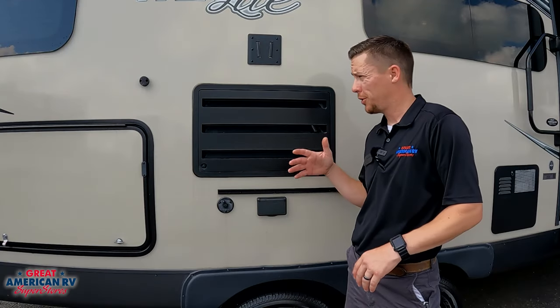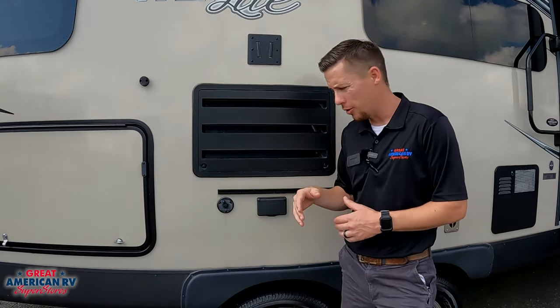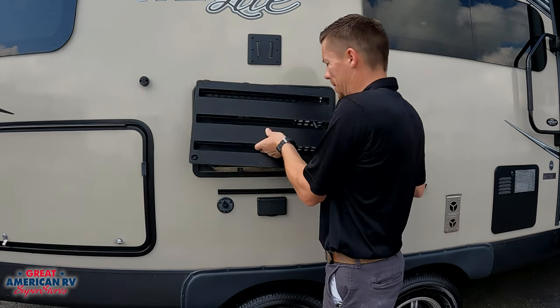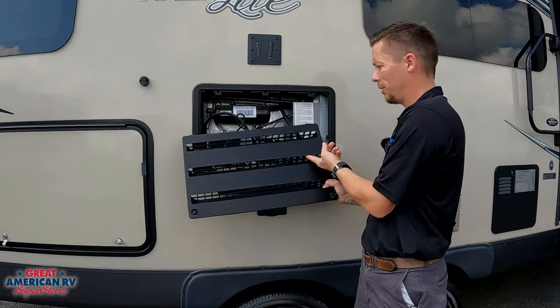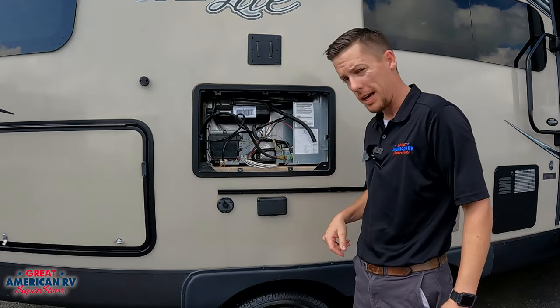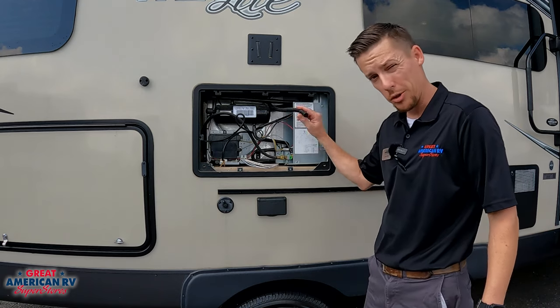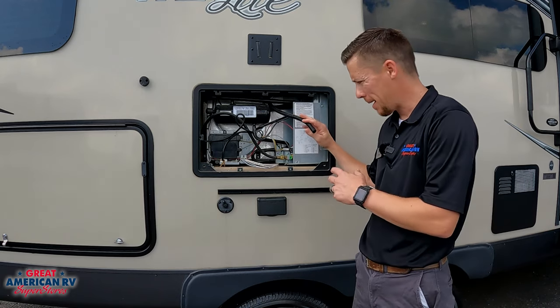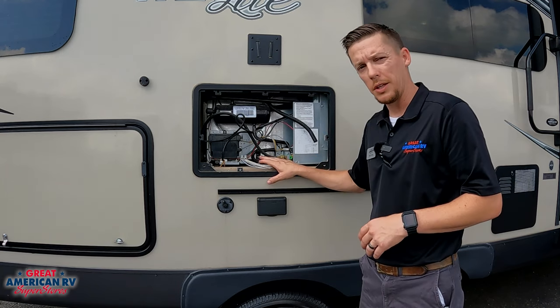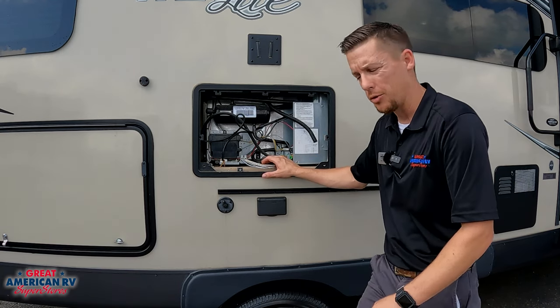Here we are on the outside of the refrigerator — it's directly behind your fridge on the outside of the unit. There are two twist tabs at the bottom. Turn those and pull the cover out. On Dometic fridges, you're going to have a drain tube that sticks out of the grill right there. Make sure whenever you put this cap back on that the drain tube is sticking out, so water doesn't drip onto the wood and rot it out whenever your refrigerator drains.